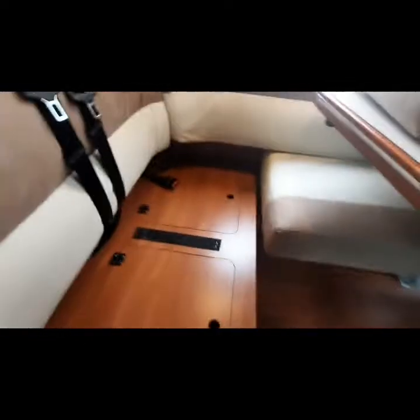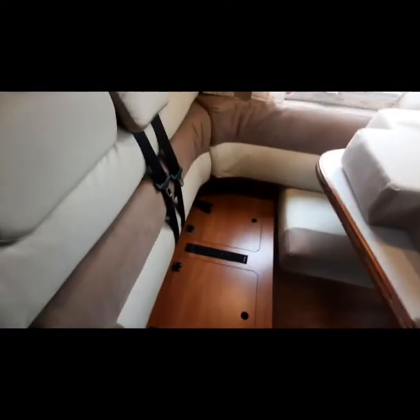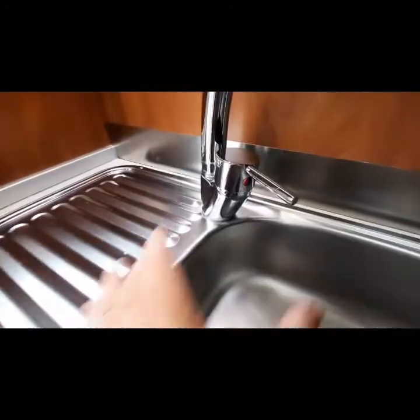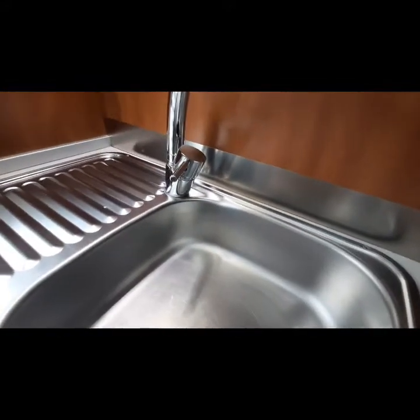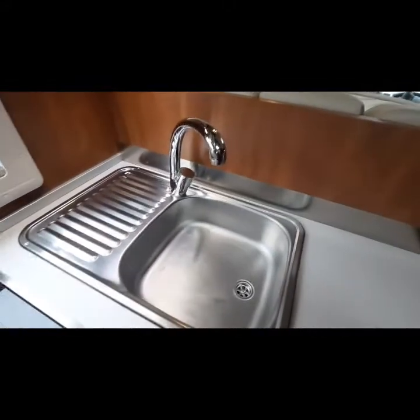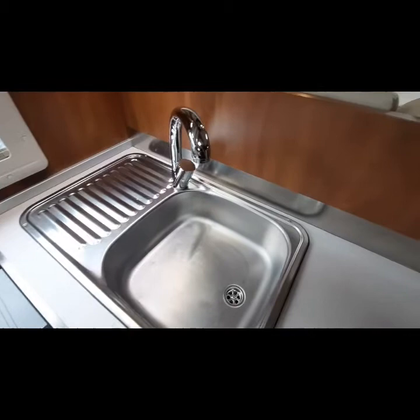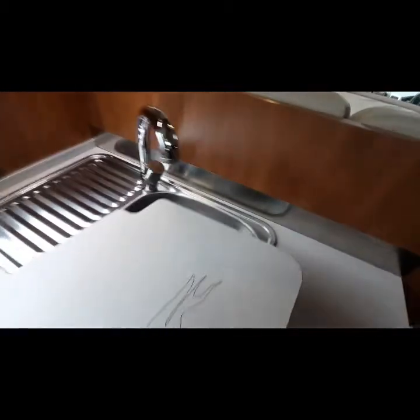There is a fuse just down there — that's your main fuse for the batteries. Underneath that is where the boiler and the Truma heater are located, along with the heating drain valve and frost protection valve, which I'll explain when you come to collect the vehicle. Once we know the boiler valve is closed, we turn the tap to hot, turn the water pump on, and run the water until you've got a steady stream. Once you've got a steady stream on both this tap and your bathroom tap, you'll know the boiler is full. You can then go to the heating system operation and turn that on — only do this for the water if you know there is water in your boiler.